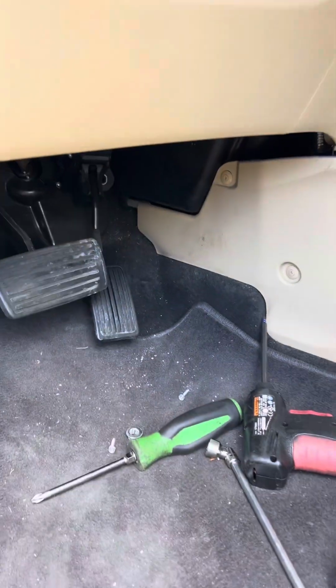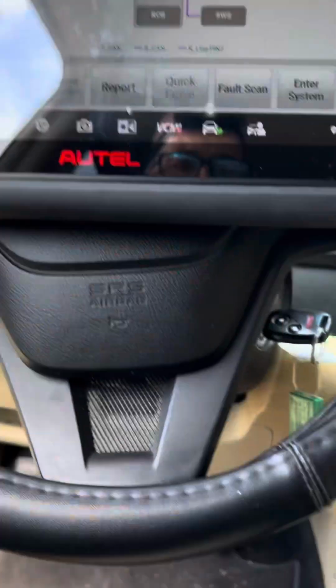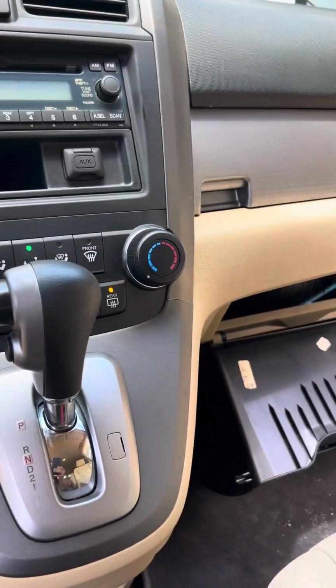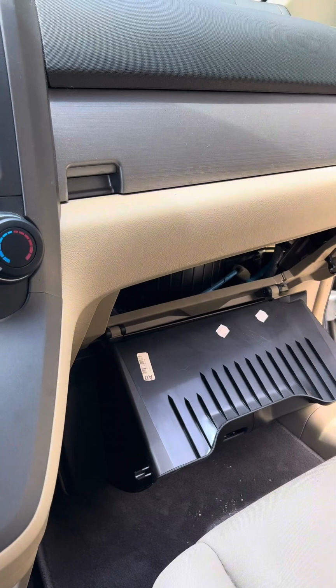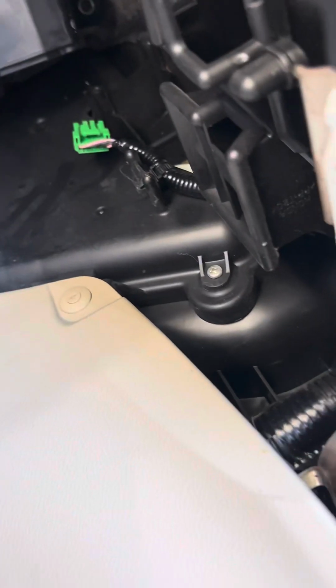And the blend door is going to be on your driver's side of this vehicle. They're not very expensive, $80 part from the dealership, and we'll put this one down the road. So I hope that helps somebody out. If you're chasing one of your blend doors, top, bottom, it's going to be over here, up here. Your recirc is over here, and your blend door for temperature control is up here.